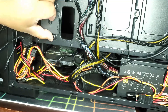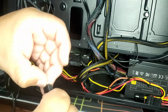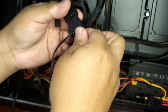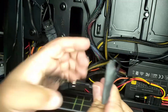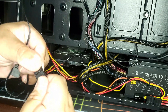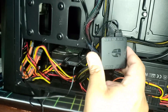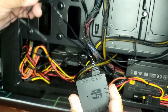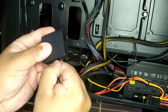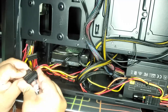This placement decision must be made before connecting any cables. Once we have identified the remote control cable and the 5V 3-pin connectors of the case, we proceed to disconnect them all. The remote control cable of the RGB fans we discard, as we will no longer use it. We cascade all the 3-pin 5V RGB connectors, leaving only one to connect to the RGB hub. Once connected, we proceed to give power to the RGB hub. We must tighten that cable very well, then identify an available SATA connector to give it power.